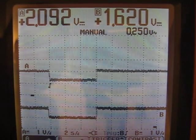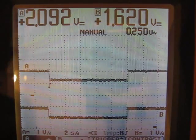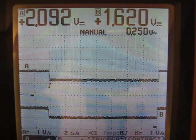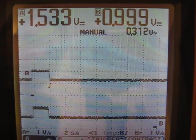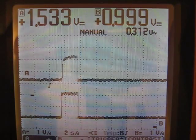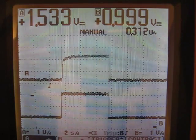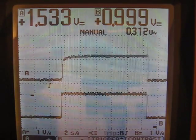So what I'm going to go over next is show the throttle adjustments and what happens when doing these. Once you set the minimum voltage it's pretty much ready to go from there. And the wide open throttle voltage needs to be set with the throttle set all the way at the maximum, hooked up to the bike with the wheel off the ground of course — unless you want your bike to take off across the room on you.